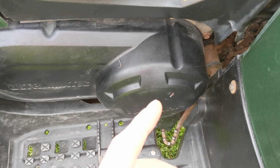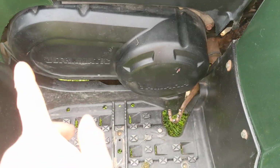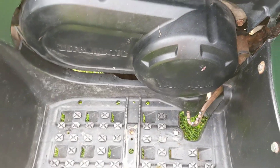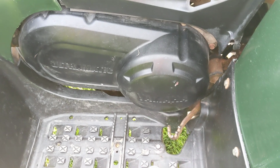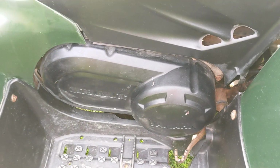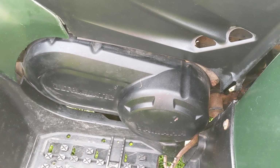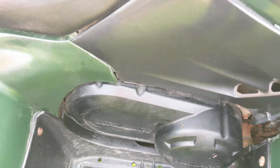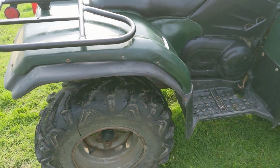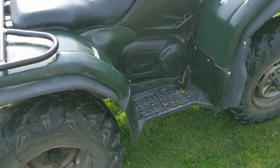It's bathed in oil, it's a wet clutch, so if people don't use proper wet clutch certified oil, that clutch starts to spin if it's hammered on and burns up the material. So that's about £300 or £400 to replace, and it's a reasonably in-depth job. The way you can test for that is just hold your brake and give it some throttle in high range. If the engine revs up but you're not going anywhere, your wet clutch is spinning. So that's the only thing to really watch out for on these. I did mention before about the boot that covers the rear main seal. Not a massive issue, just a few hours work.